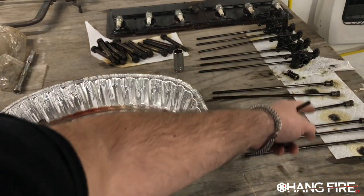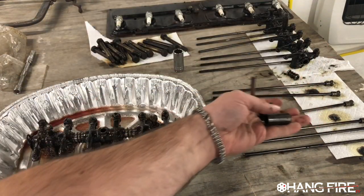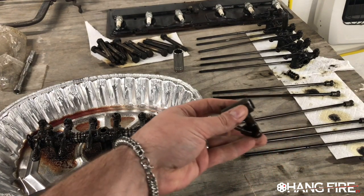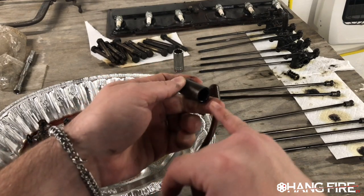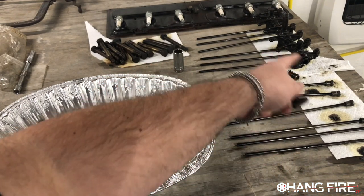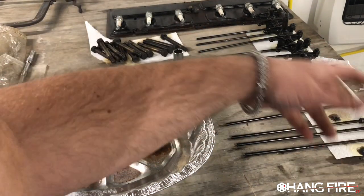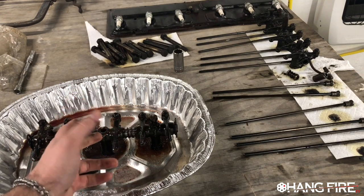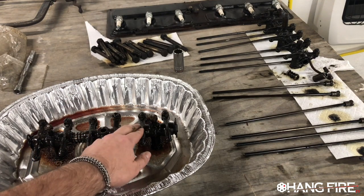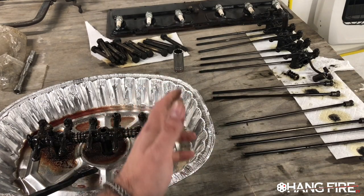This is two halves. We've got the back and we've got the front over here. This is clearly labeled. It's labeled on the other side. And then we've got an oiler. This sits in between the two. Oil comes up from the bottom of the engine and sprays into this, and it runs down the length of these two tubes here and oils that whole valve system. It's a really cool, old piece of kit. It's just beautiful, beautifully machined, nicely made stuff. It's all made to be serviced. It's made to be worked on.